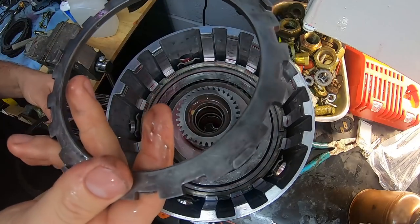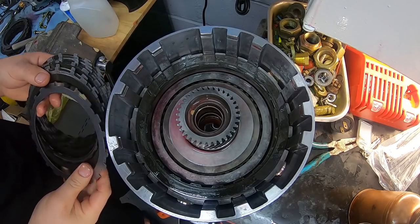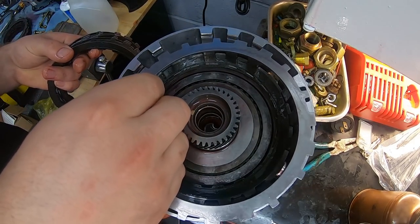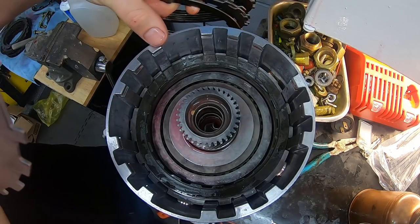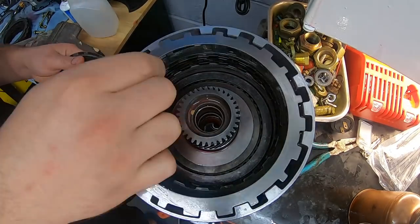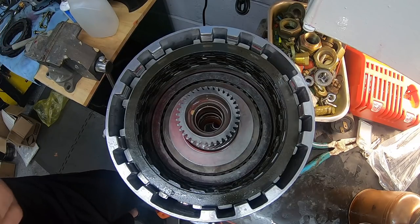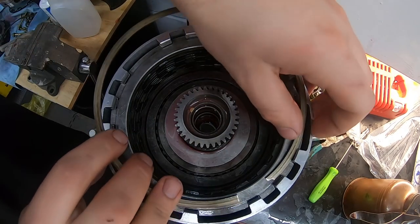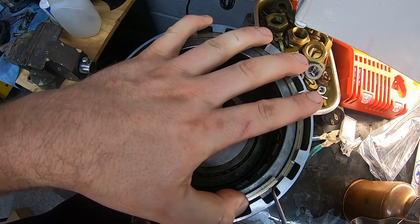Got our thick plate going down below with the notch facing down, then the same clutch, steel pattern all the way up to the top. When putting the clutches in, there's a notch - you want to leave the groove space open because we have to put the springs back in. Make sure this groove is getting the clearance. Before putting the top plate on with the snap ring, drop these little springs back in. Then the thick plate goes on, snap ring installed.